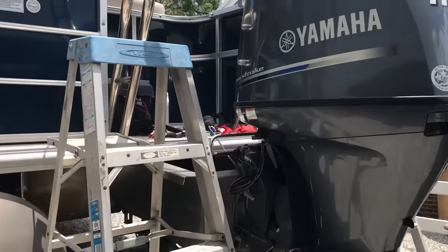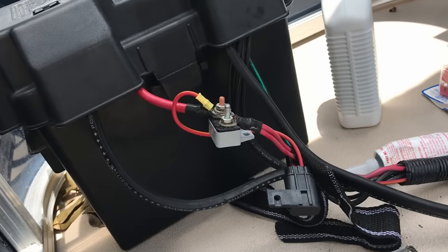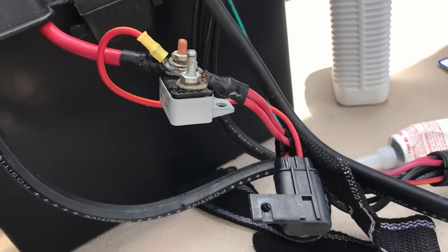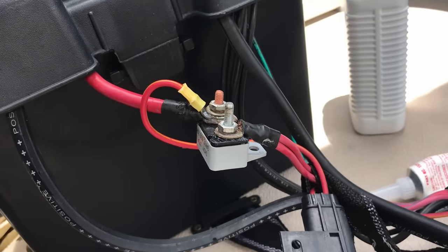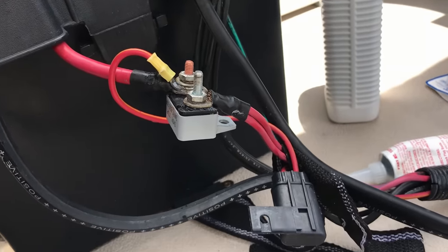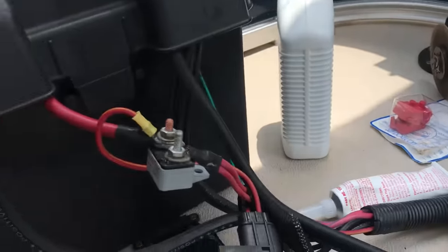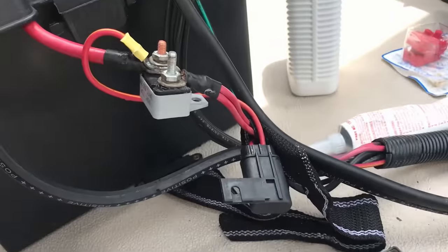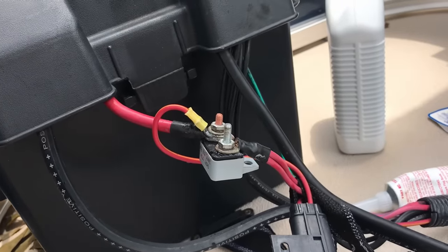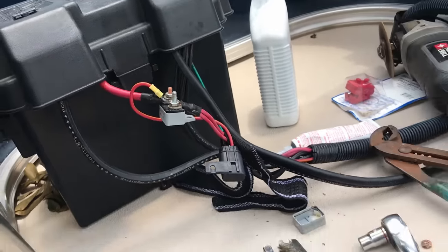All right, so this became a video about a breaker, and I've got everything up and running again. I just loaded that up with the dielectric grease, which is a really good grease for electrical components. Helps avoid corrosion and keep good contact. Anyway, everything's working. And I didn't put the boot on. I don't like the damn things. They're really just in the way. If I change my mind, I'll have it in the battery compartment. But I'm gonna go commando for now and keep an eye on this thing. We'll talk soon. Thanks for watching.